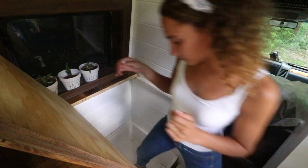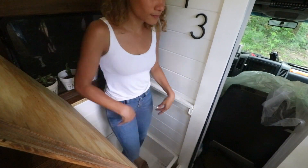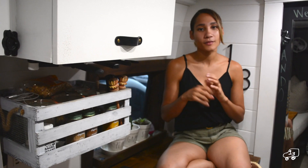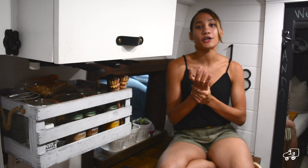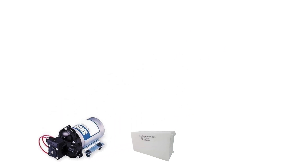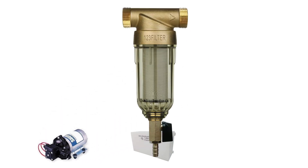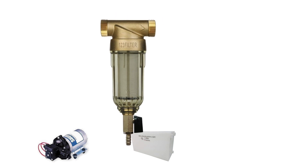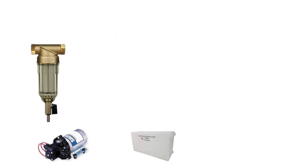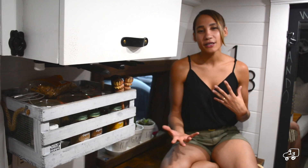The other benefit of this hidden space is that we created a recirculating shower with five gallons. The way we did that was by using three different filters. First we have the five gallon water tank under the van. We connected that to the water pump and that pushes the water into the van from the bottom. Next it goes through our strainer — the Ice Spring 50 micron strainer — so that takes away sediment and big pieces of debris, which for a shower helps with things like hair.